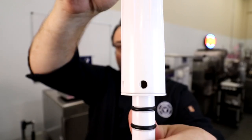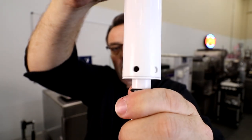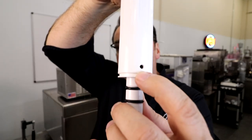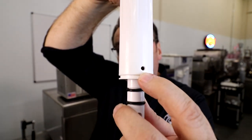This one actually has the flow hole down at the bottom here, and it's actually adjustable — you can make it bigger or smaller depending on the type of product you have. Most manufacturers do have an adjustable flow valve or carburetor that allows that mixture to pull through. But again, same principle: if I am putting anything flavor-profile-wise in my hopper that is larger than that hole or can clog it, then you're in a world of hurt when it comes to freezing your product.